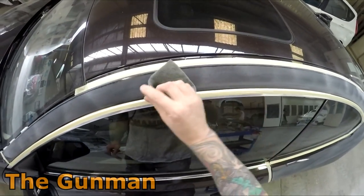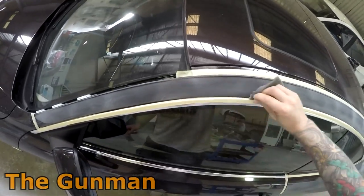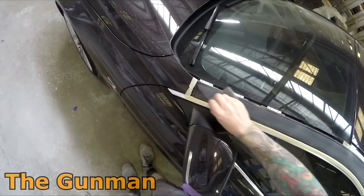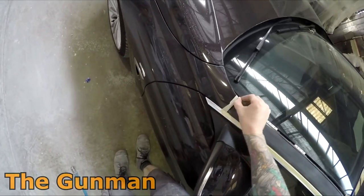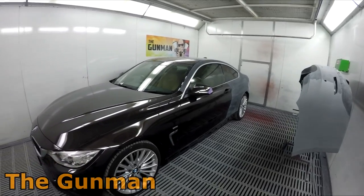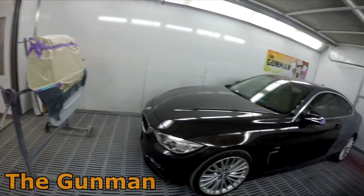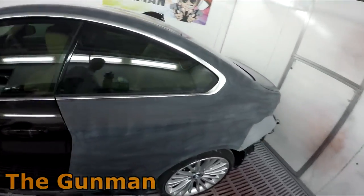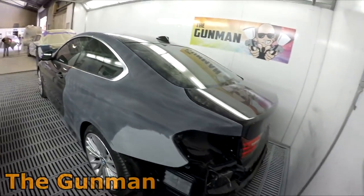As you can tell, I'm obviously not going into much detail on the prep work in this job. We'll just get it straight in the booth and start painting. I did block it all down and then buzzed down the surrounding blend areas. I used 600 — you can use 800, 1000, whatever. I've then got it in the booth, prep's all done, blown it all off, then we'll get it masked up and splash some paint on it.